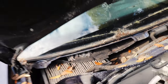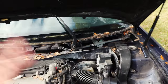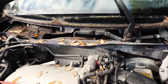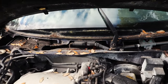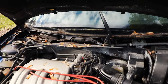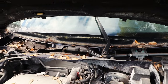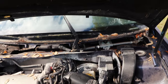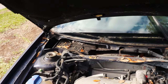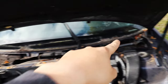They clip into the window sill itself, so you've got to break away that fitting next to the windshield and then everything else pulls off. But mine had a crack in it right where it covers up the ECU, so when I put a little bit of tension into it, it actually broke completely. They're like 40-50 bucks, should be cheaper than that. My cabin filter is pretty nasty - I think we need to replace that. And somehow the liner under the dash is coming off too.